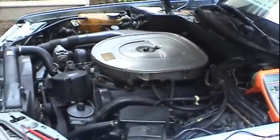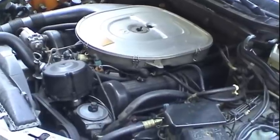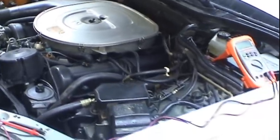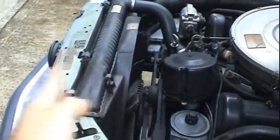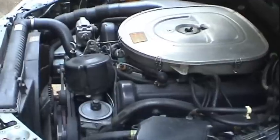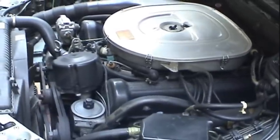And at the time that I did that, once I had the engine running that same night, I went ahead and took the opportunity to try to reproduce the problem, because the fact that it started after it came off the tow truck was telling me that this is not only potentially an electrical problem, but also a heat-related electrical problem. Essentially what happened is that when I shut the thing down to have dinner, that was what we call a heat soak, where the engine is shut down, the water pump is no longer turning, there's no longer any air going through the radiator, the hood's shut, and there's no air going through the engine compartment to keep the engine cool. So temporarily the engine will actually increase in temperature and then fall back down to ambient conditions after several hours.